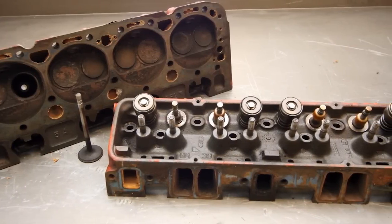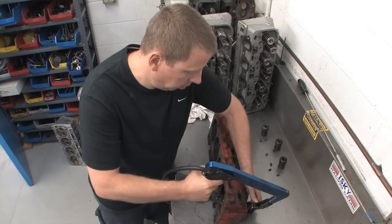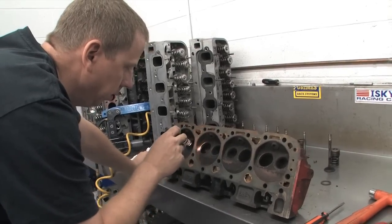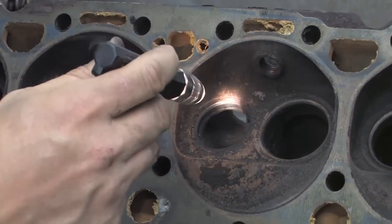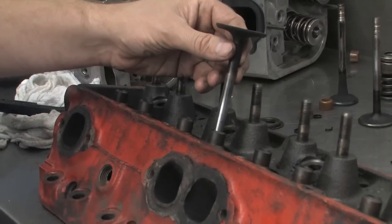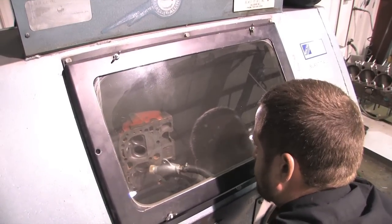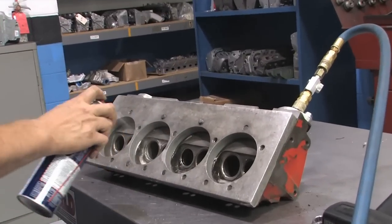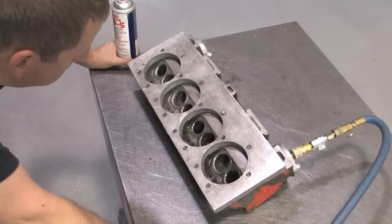It's a different story with the stock Chevy heads. These are Chevrolet 882 large chamber heads. We would have preferred the more performance-oriented double hump heads, but most have been picked over by racers and a well-used pair will run you upwards of $300. After an initial inspection, we found these heads had already been repaired with oversized exhaust valve guides. We magnafluxed both heads and found small cracks around one exhaust valve seat, so Dorton pressure tested that head. Thankfully, no leak was found and our comparison could continue.